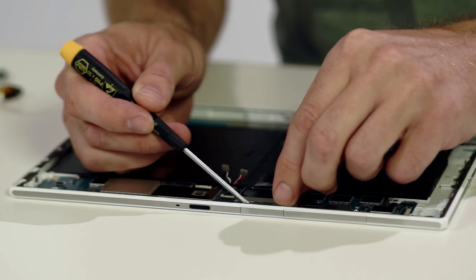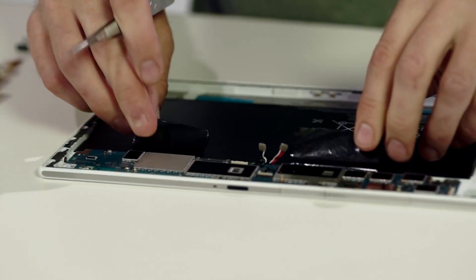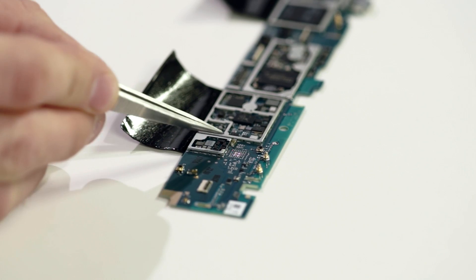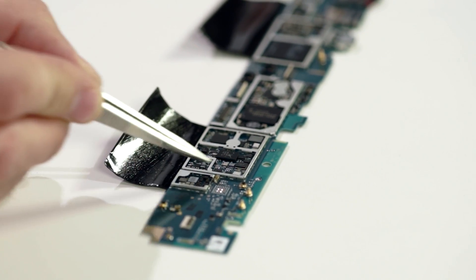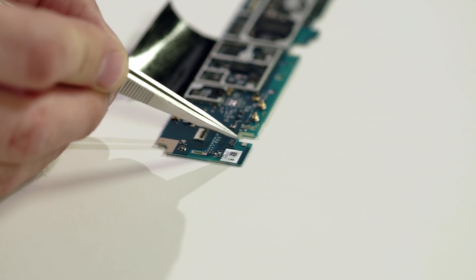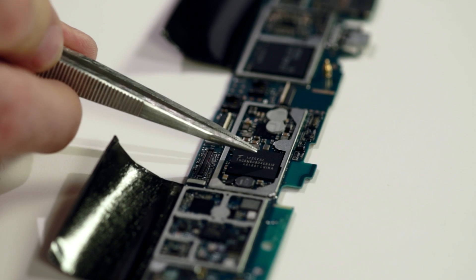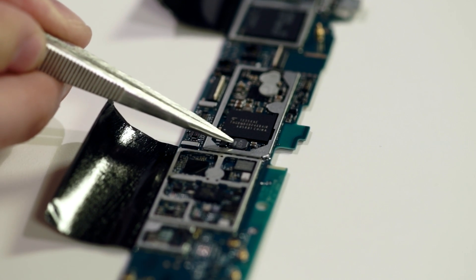Let's also unhinge the USB port. Almost to the motherboard now — one last screw is keeping the board seated and we're ready to pull it up. You can see it has shield cans. After removing the shield cans, we can take a closer look. We have the right speaker amplifier and next to that a connector. We also have a section called no mount — this is used for the Japanese version with digital TV components. Next is the LED light and the cellular network component. The larger piece on the motherboard is the memory, which varies from 16 to 32 gigs. To the right of it is the light management unit, or LMU.